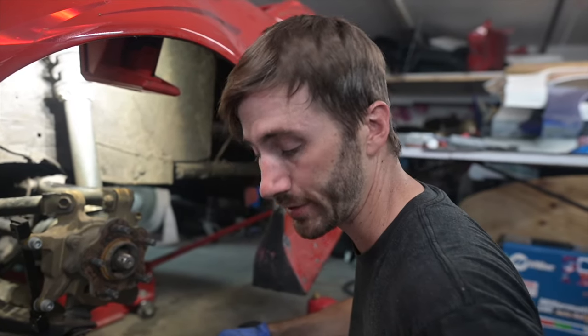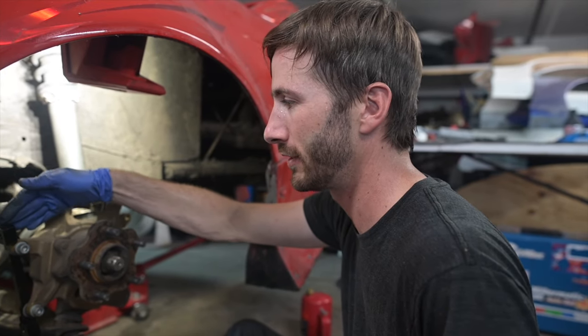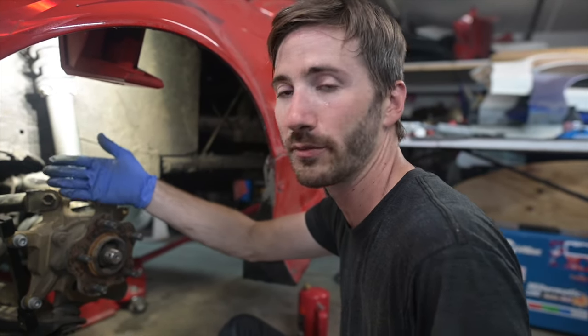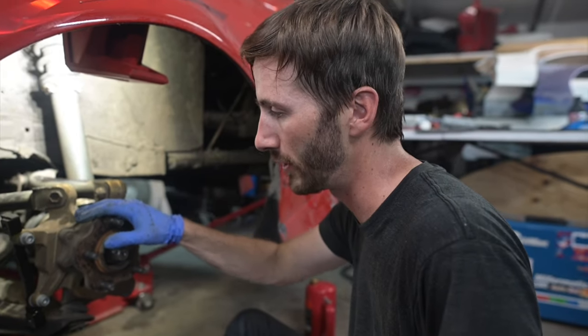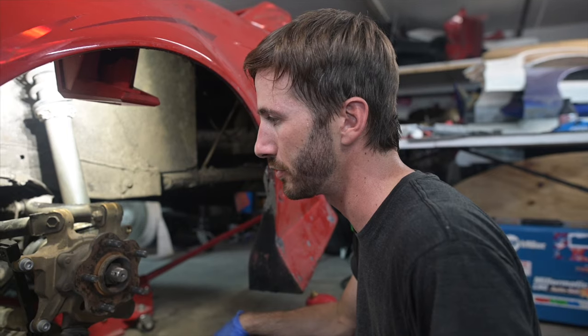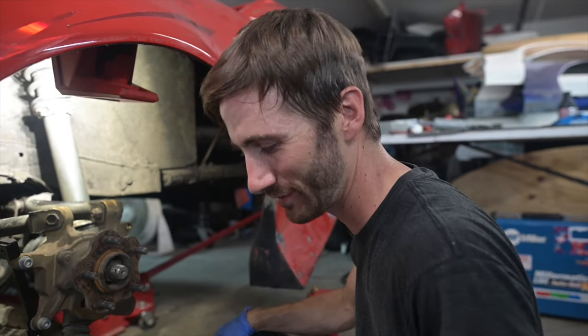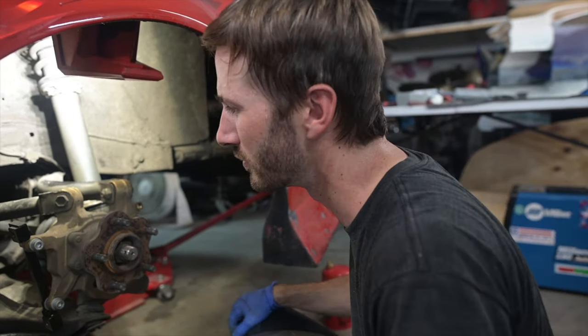The front was just the same. I didn't film the front. Sorry, everyone. It's just like this, only one less brake line. But very simple setup. You got a shim stack, you got a bracket that goes on the factory knuckle or an aftermarket knuckle that's got a factory spacing for it. Check your rotor with the wheel spacer put on, bolt it on, measure it, make sure it's good. If it is, send it. If not, pull it off, redo it.